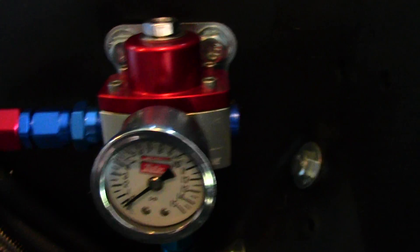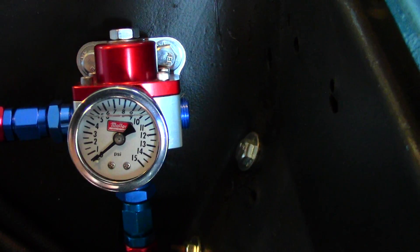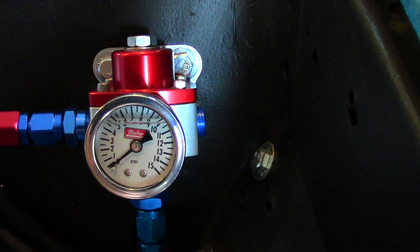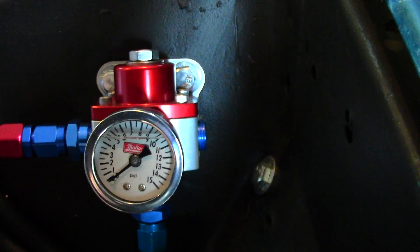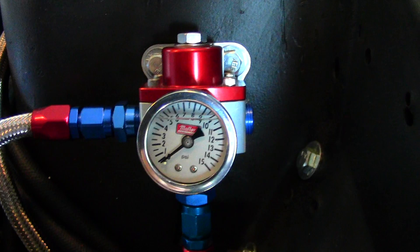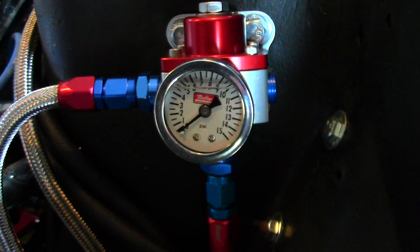You've got two different gauge setups: your mechanical fuel pressure gauge, which you normally run between zero and 15 PSI, and your fuel-injected pressure gauge, which runs much higher pressures — those gauges get up into the hundreds. That's just a quick and dirty on fuel pressure regulators and why they're important. You can really fine-tune and troubleshoot a lot of issues with a fuel pressure regulator if you know what fuel pressure you're running at all times.